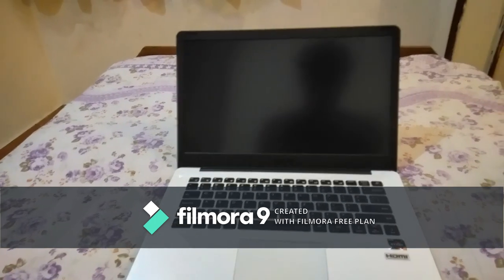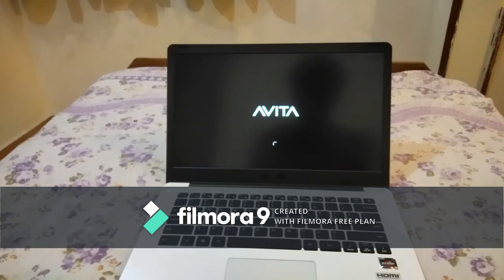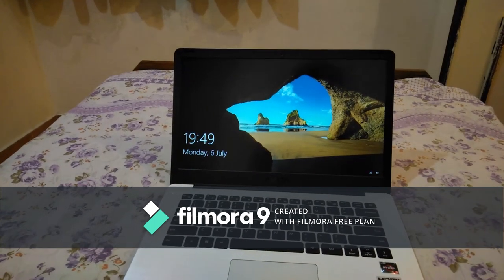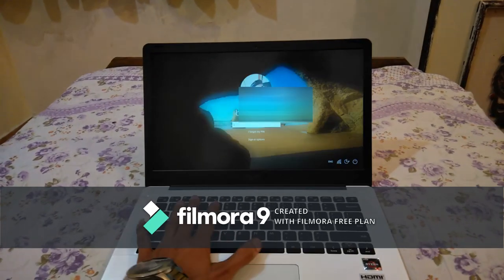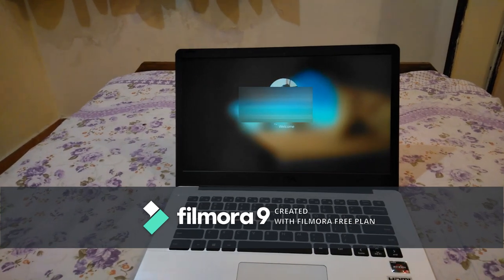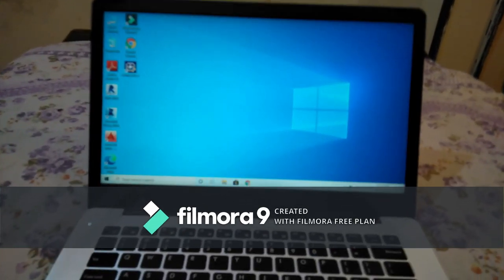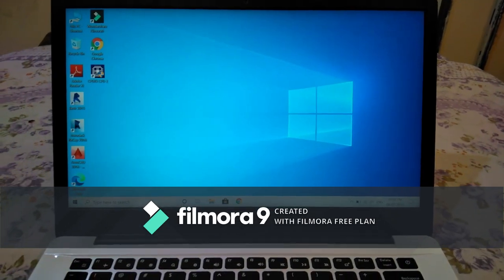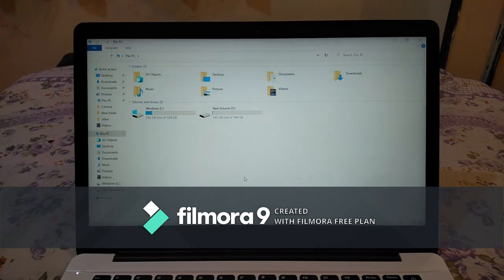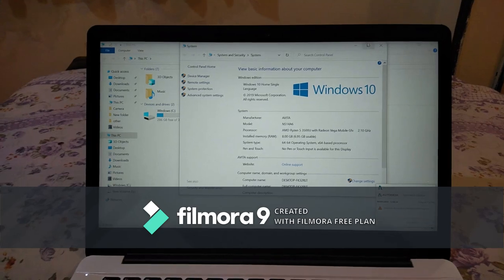You can't upgrade the SSD or RAM after purchasing. The SSD and RAM do make the laptop faster. This device is supported by Radeon Vega 8 graphics, which is internally built into the processor. The graphics uses 1GB of memory from the RAM, so you can see in the properties there is only 6.9GB of usable RAM.